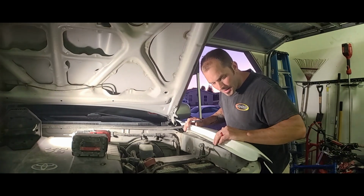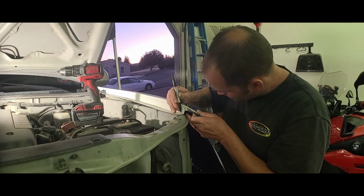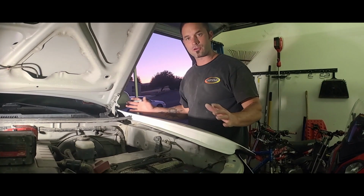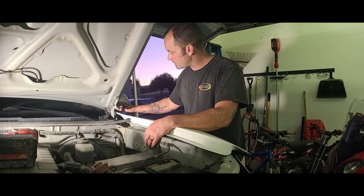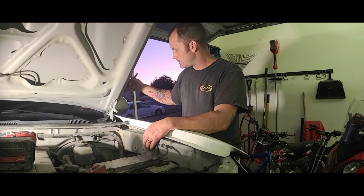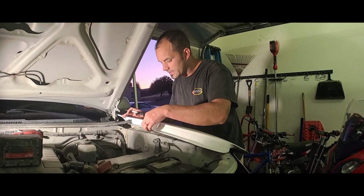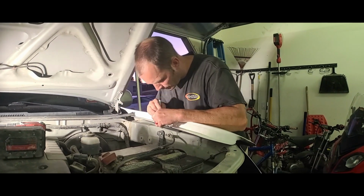All right, we're marking holes on the fiberglass. McNeil does a pretty dang good job at marking. They kind of leave these little circular indents on the fiberglass, and it's pretty good. But you want to make sure your fitment's good, and remember, this flexes and molds and pushes, and once you get fabrication, or once you get the molds going and you trim and do whatever you have to do, look at their marking lines, but then just put this into place and double check and look on the inside and try to eyeball it and mark it.